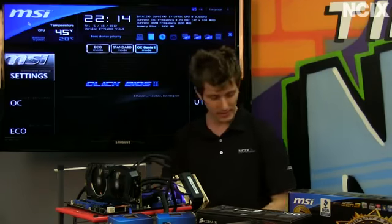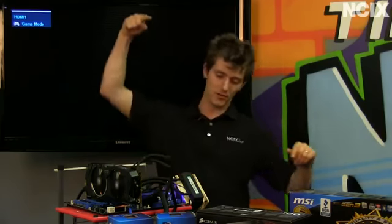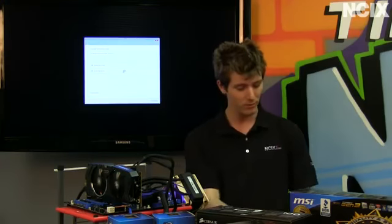you are going to see that, if you don't go into the BIOS by accident, sorry about that guys, we are going to boot right into Windows with the touch of one button while the computer is off, and we are going to have an overclock that, while it's not as aggressive as you could manually tune, is certainly functional and certainly faster than the processor was from the get-go. So in this way, MSI, and for that matter the other board manufacturers, have similar overclocking tools, although OC Genie I'm particularly fond of just because it's super simple and always works.